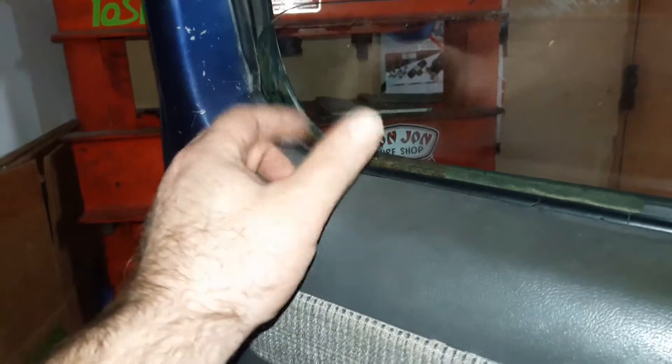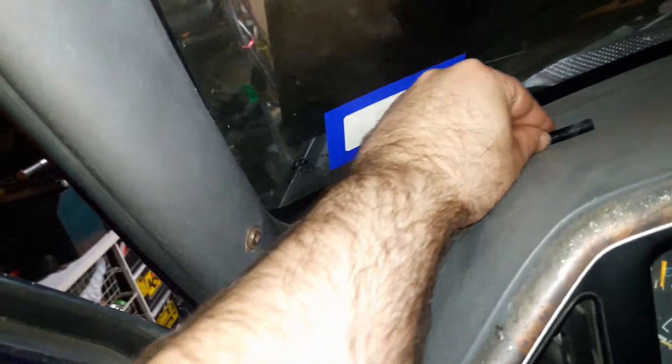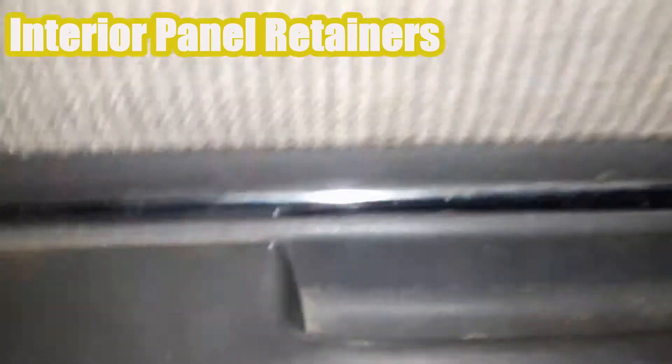So we pulled the panel off of that side and I'm gonna show you how to pull it real quick — it's not too difficult at all. I started by unscrewing the door lock; it's just a threaded piece of plastic. Try to stick all the parts where they won't fall. This door panel is basically held on by these little pop rivet clips. After you pull the screw out of the armrest, look around for anything else and follow the seam all the way down. This panel separates from this panel — you don't have to take this panel off, but you can.